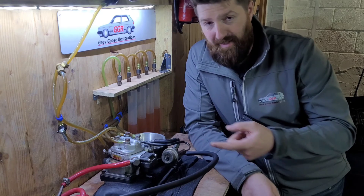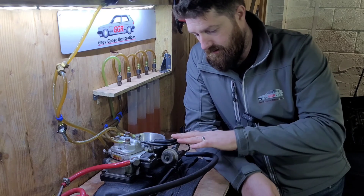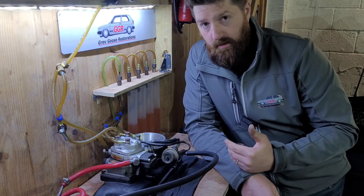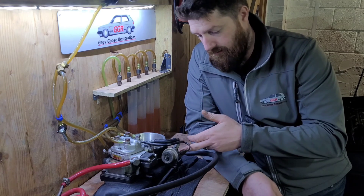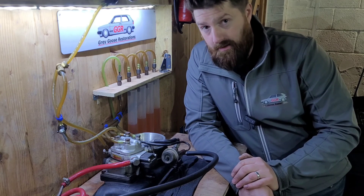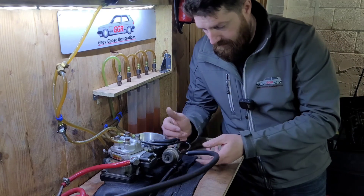There are two types of these pressure regulators: one is 5 to 5.5 bar and this one is 6 to 6.5 bar — only two differences. This particular one is the higher rated unit, currently at 6.2 bar. Inside there's a little valve: fuel pressure comes in, sits inside, and goes back to tank. At a set point, pressure gets high enough to unseat the valve and divert fuel back to tank.